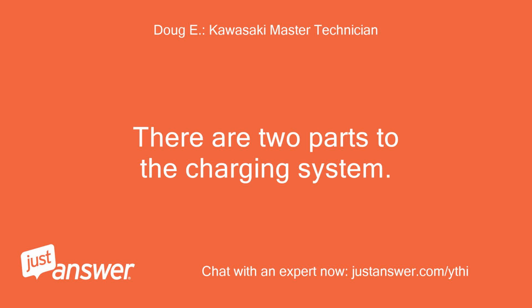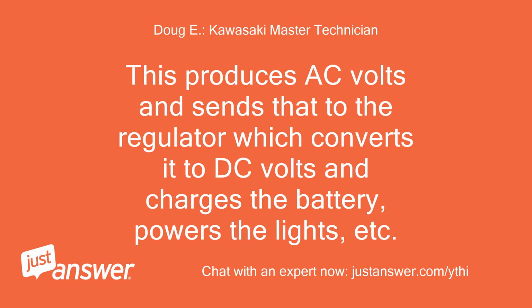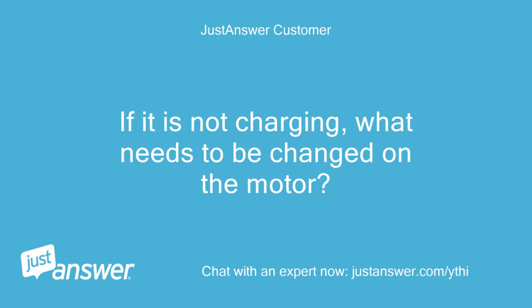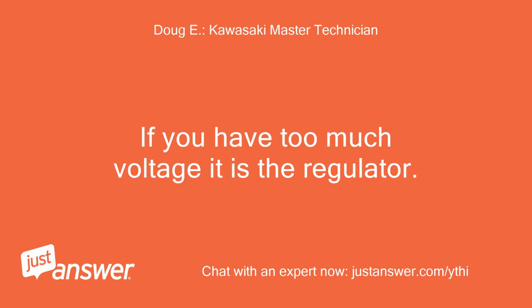There are two parts to the charging system. There is an alternator coil under the flywheel. This produces AC volts and sends that to the regulator, which converts it to DC volts and charges the battery, powers the lights, etc. If it is not charging, what needs to be changed on the motor? In most cases, if you have no voltage, it is the alternator, or a broken wire from the alternator. If you have too much voltage, it is the regulator.